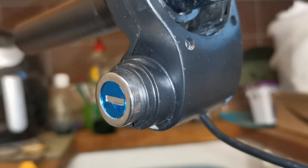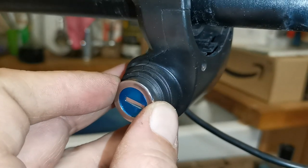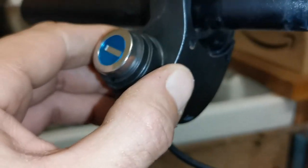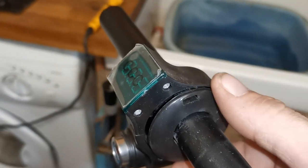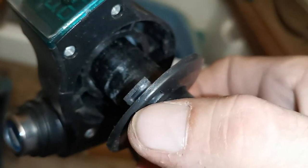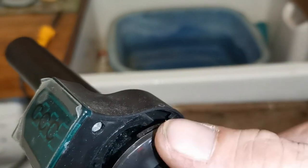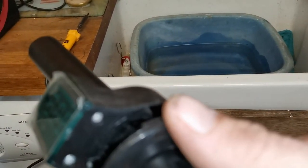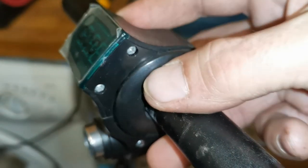Once you've got the plastic cover back on, just check that it doesn't wobble around inside the case. Go ahead and replace the screws here, here, and here. Once you've got all three screws in, reattach the disc. Near the holes on the outside there are little clips and they only do up in one direction — they clip on to these bits. From the top, make sure that the clip from this side is to the left of that, then push it all the way on.